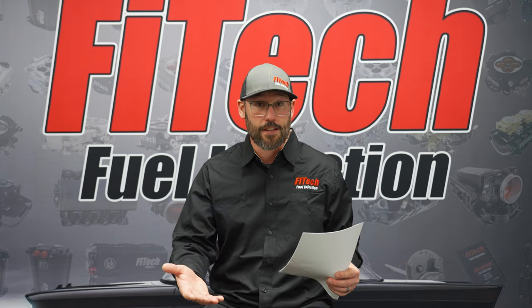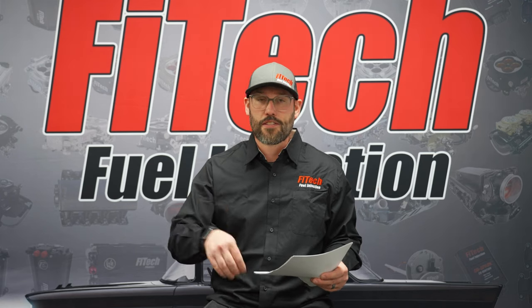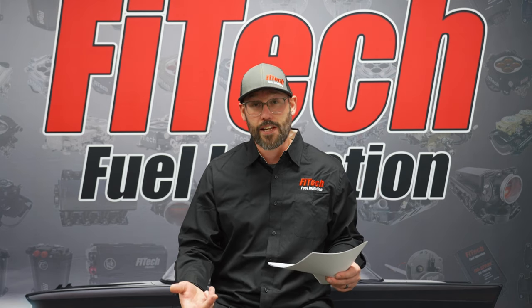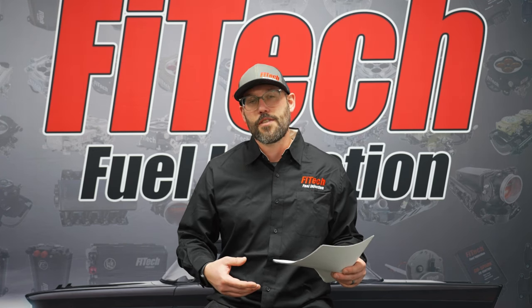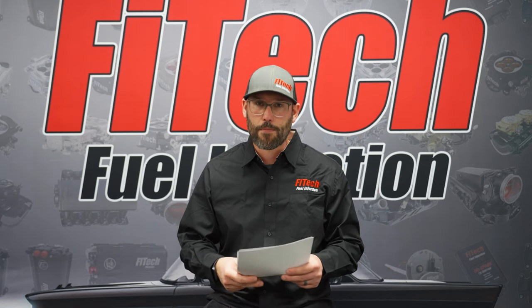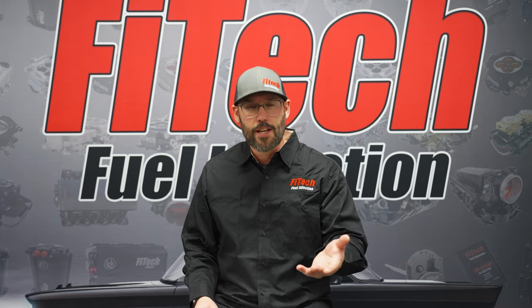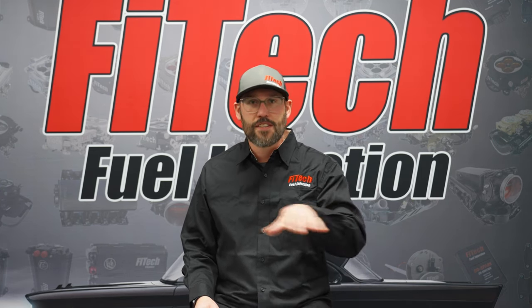Sometimes it's something external. If you have an exhaust leak — which may be where this question stems from — the exhaust leak allows oxygen into the exhaust, that oxygen gets to the oxygen sensor and makes the system read lean. Because the computer sees that as lean, it tries to add more fuel, but the exhaust leak doesn't go away just because more fuel is added, so the engine keeps learning to run richer and richer. Other things that can cause that too: a vacuum leak or a cylinder misfire, like burnt plug wires, can cause rich conditions as well.